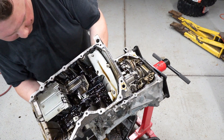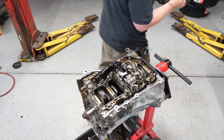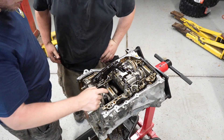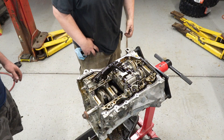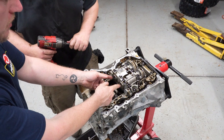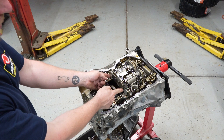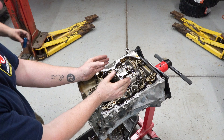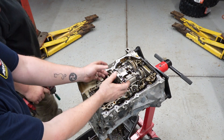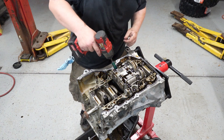Nothing like shiny stuff in the pan. It's just goo — just sludge. You will get a certain amount of sludge in a normal engine, that's normal. Plastic oil pickup going to your chain-driven oil pump. You know what that is, Sam? That's a balance shaft. So this is set up to take out the vibrations. These two balance shafts are geared, driven off the crankshaft through a giant gear that's pressed onto the crankshaft. They're basically a shaft, but they machined out half of it so it's only weighted on one side. My Civic had one of these and we took it out — that's why it rattles so much. The more you know.